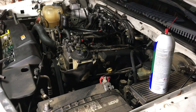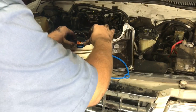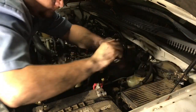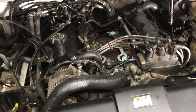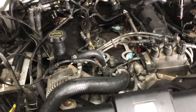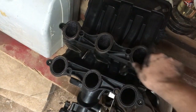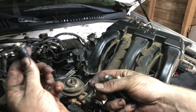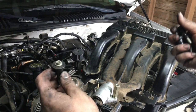Now it's just repeating the same process for the other side. Then it's just a matter of putting everything back together in reverse order. Before you put the intake back on though, clean that mating surface. I'm going to go ahead and replace the intake gaskets — they're just six individual rings that come in a kit. You do it the same way you did the valve cover gaskets. The intake bolts sit in boots, so I'm going to snap them into place before I put it on the engine because the very back ones are real hard to get to.